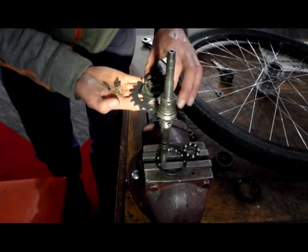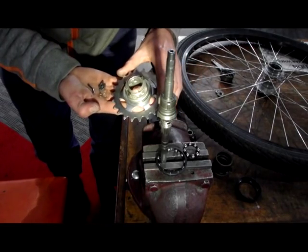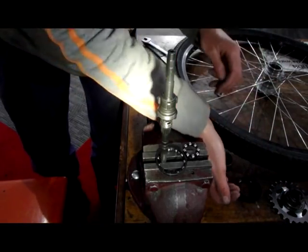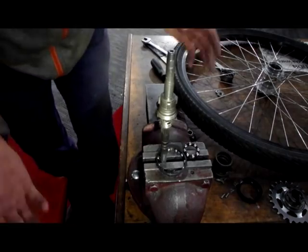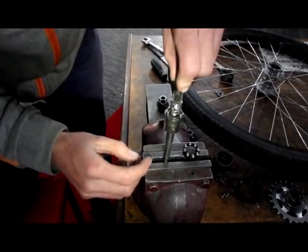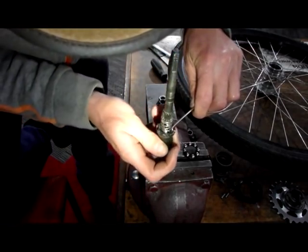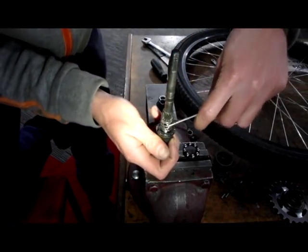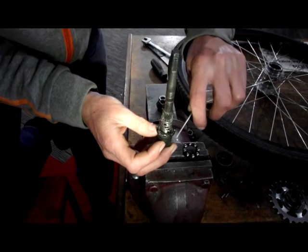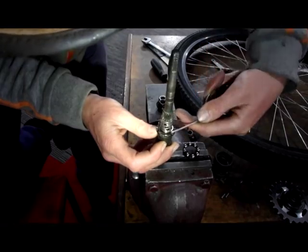The plastic grease guard comes off. That completes the disassembly of the hub unit. We can further disassemble the axle by digging a special tool circlip remover in one of two notches — one there and one there. The gap in the circlip is there, so we need to dig behind the circlip and twist around under the circlip.